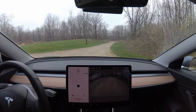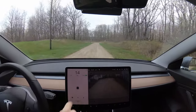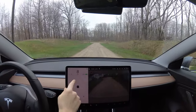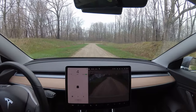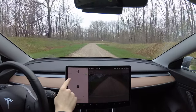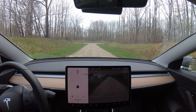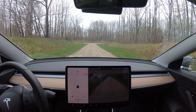So here I'll move forward. You can see I'm using energy and I'm going to let off the accelerator. So now I'm gaining energy. I'm going slow so I'm only gaining a little bit, but if you're going 40 or 50 or more miles per hour and you let off, this green bar is going to go all the way to the limit and I'm not going to be able to slow as much as if my battery was warm. Throughout the drive I'll update you at the end — there will be no dotted lines so I'll have my full regen ability back with my warm battery.